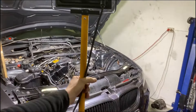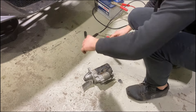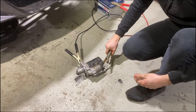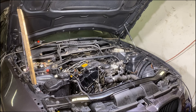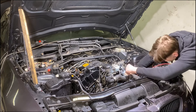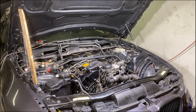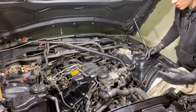After running a bit the car started to jump in revs, so I turned it off, and when I tried to start it again there was no crank — nothing. I spent a good time diagnosing and found the starter had failed — it's a secondhand starter. When cranking the engine to build oil pressure the starter got hot and went bad. I managed to remove both starter bolts — one from the top and one with a long extension from the inside — without removing the manifold.